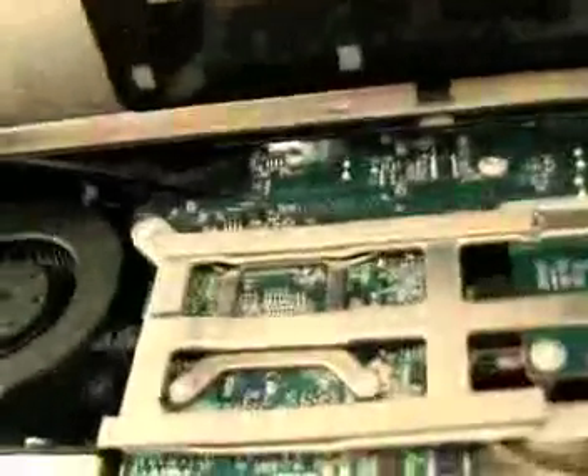And there you have it. Just unscrew those and install your hard drive. As you can see, this is what needs to be disconnected — this cable here and the cable down there. Try to remove that. As you can see, it's removed. As you follow this line, you want to take that out so you can release and get the monitor out of your way. It's always good to take pictures or video to record so you can remember where to place things, because that's where you get into trouble.